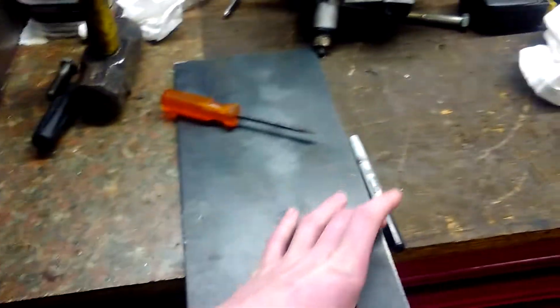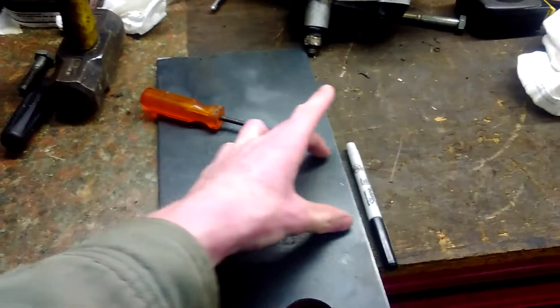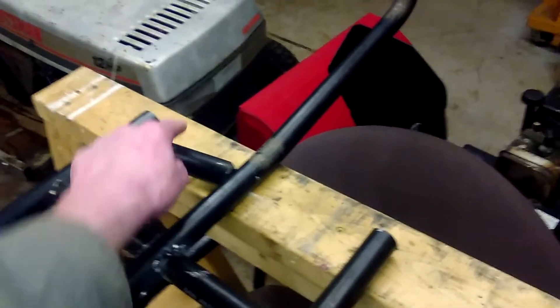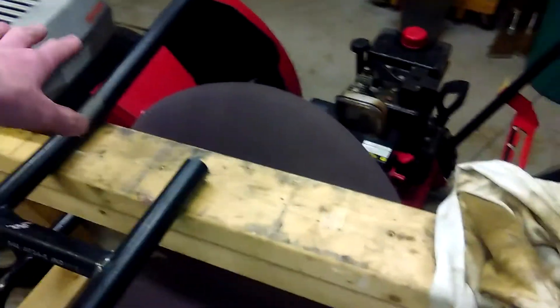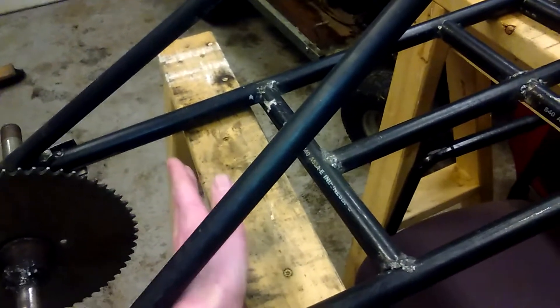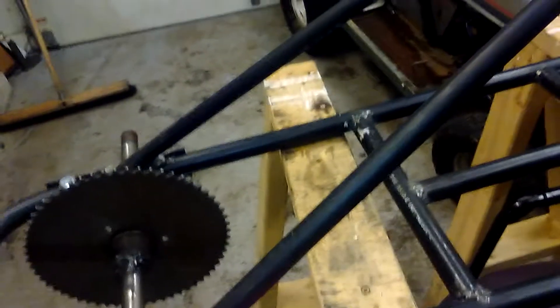It might be all one piece. I might cut it — I could lose about this much steel if I cut it, but then I'd have to support each one separately. That wouldn't be a problem because the motor mount is going to be here, and the tranny mount would hang off the back of this, which means I'd need a support there anyway. I'll probably cut that engine plate in two — just save some weight there.